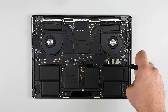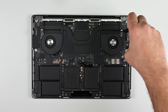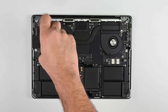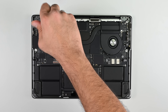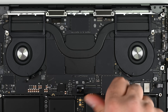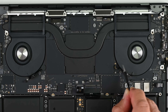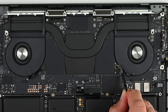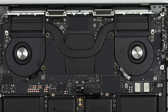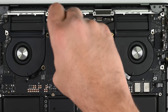Logic board removal in the MacBook is a bit of a process, which is a gentle way of saying it's incredibly complex and tedious. We've now moved into the final stretch with several Torx 4 screws and three Torx 6 screws that are visible, and four Torx 4 screws that are hidden underneath these weird little foam nubbins. You can use a bit of isopropyl alcohol to help remove these without tearing them, but I honestly don't know why they're a thing and I have no intention of putting them back when I reassemble this device.